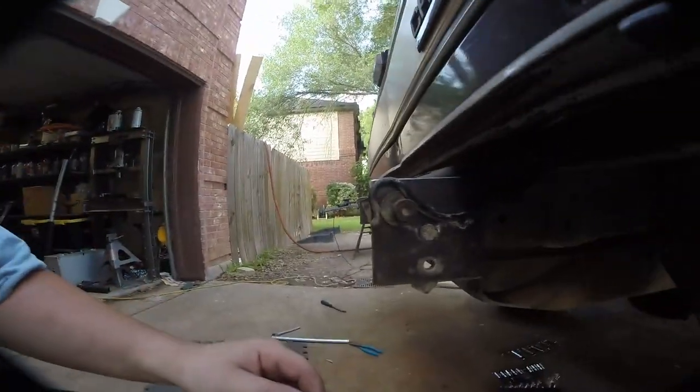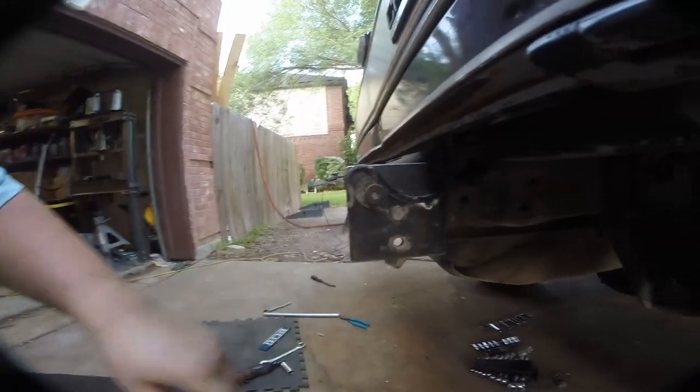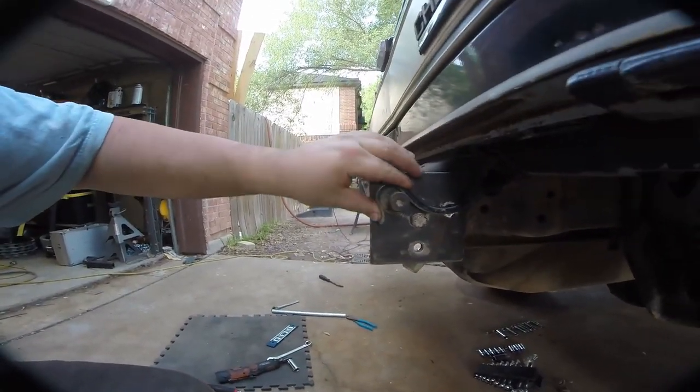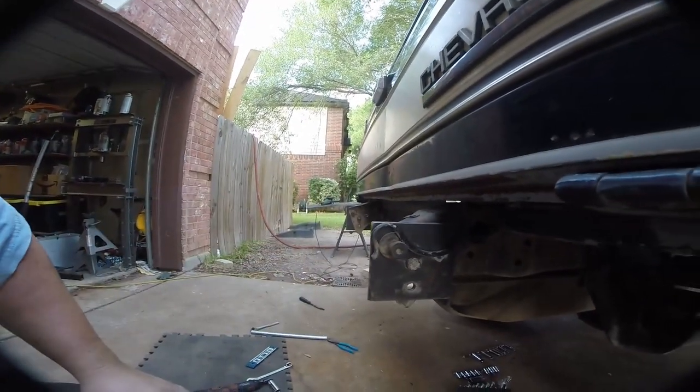The first thing is we got to build some bumper mounts, and for that it's nothing more than a little cardboard aided design and cut out some quarter inch plate. We got our plates drilled out — I can put three bolts in here and this actually curves down quite a bit. These are now vertical so we can basically go and cut our bumper plate.